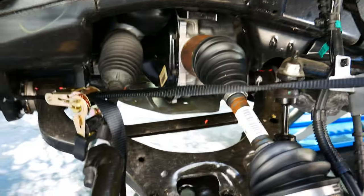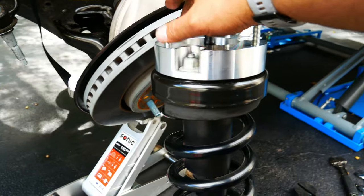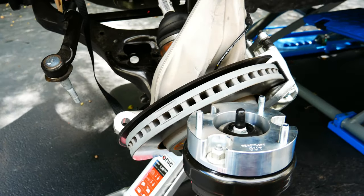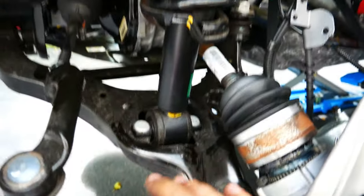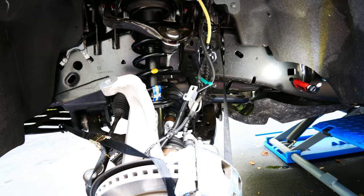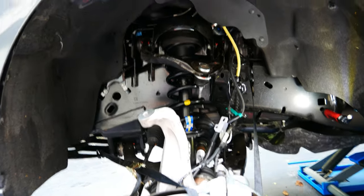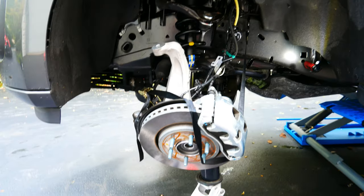The shock is out and I'm out of breath. It's going to be a hard time to put it back in, but let's jump into that. I put the front spacer on here using the stock hardware, torqued down to 30 pounds. Now it's time to finagle all of that back in there. This is how much longer it is — this is the lowest I can get the lower control arm without stretching the wires anymore, so I need about three inches. That seems like a two-person job, but the strut is now back in. I have to tighten everything I loosened and put it all back together.